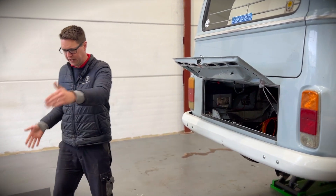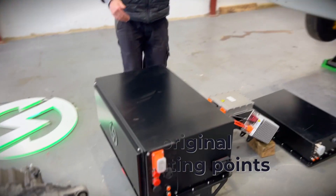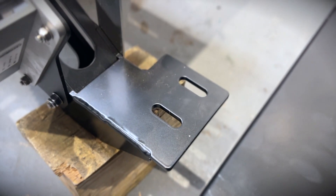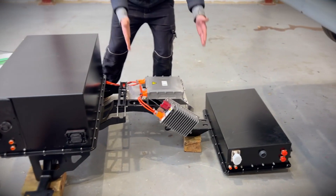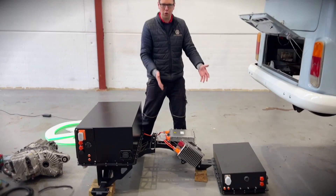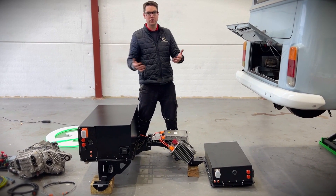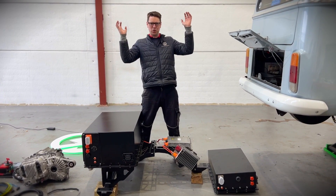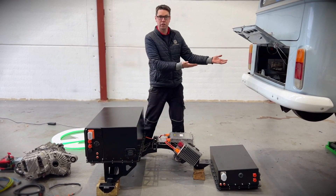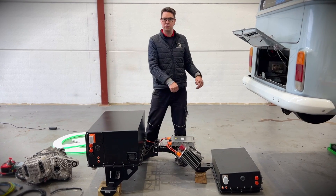On this subframe section, you'll see mounting points on the two front edges — one each side — and an engine and gearbox mounting point in the center, plus another gearbox mounting point on the back. We've used the original mounting points because the campervan was designed to hold weight in those areas. We've also taken into account the space inside the vehicle, since unlike classic cars, the campervan has to be installed from underneath. You roll it under, lift it with a gearbox lift or pallet truck, and connect it onto the two side mounts and the back mounts.